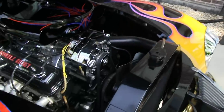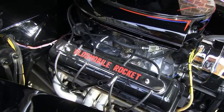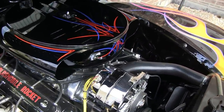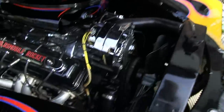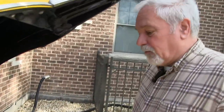I would call it timeless — black and white, whitewall tires, louvers, and a white interior. It's really not dated. I got these from the aftermarket from a company called Technostalgia. They're Oldsmobile-type valve covers that fit a Chevrolet engine, and the same with the Batwing air cleaner. So it's kind of disguising the Chevy engine to look like an old engine from the '60s — something you'd put in a hot rod before the small block Chevy came out. If you look closely at the intake and exhaust ports you'll see it's a Chevy, but the intent is not to fool anybody — it just fits the type of car I wanted.